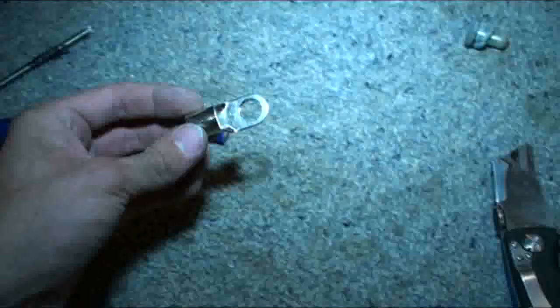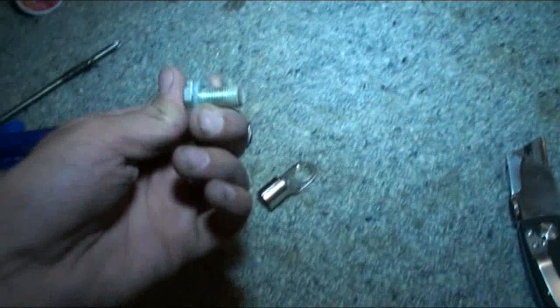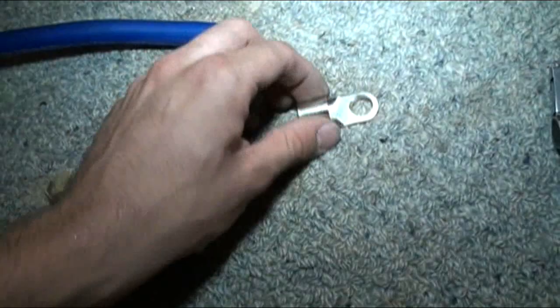For the negative, I'm using one of the seat belt bolts. Obviously it's a strong bolt, but it's a good ground. So I just drilled that out, then with a step drill — because obviously the hole was too small to start with, I think they're a quarter inch or whatever — but there we go, that's that.